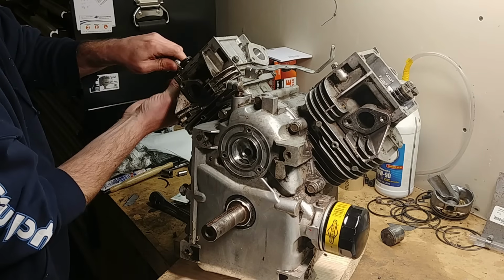It's pretty crude, but go to the store and buy one of these. It's a suction cup on either end and some valve grinding compound. It's dirt cheap. It lasts forever. You treat it like you're starting a fire with a stick. It's an abrasive compound that mates your valve seat to your valve. It just revives the seal and makes sure that you've got great sealing performance so that you don't have any blow-by or leaks that would cause performance issues.